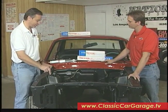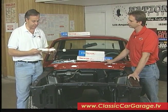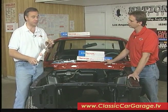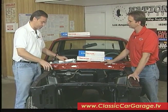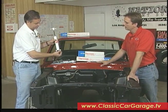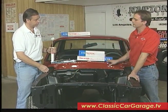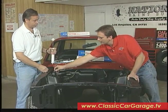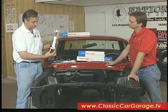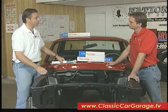Replacing shock absorbers is really not something that's terribly difficult or complicated to do. Most home hobbyists with simple mechanical knowledge can do this. We've got our shock absorbers here — these are KYB gas adjust shocks from California Mustang, and these are the correct type for this particular car. We have some simple disassembly to do first: we've got to disassemble the bolts underneath, which are these studs sticking down. It just takes two sockets — a half inch and a 9/16 socket. We'll take the top cap off, slide the assembly back in, attach the shock to the upper cap mount, and it's all done. We've got two nuts down here, another two for four, and these three which makes seven — and that's all there is to it.